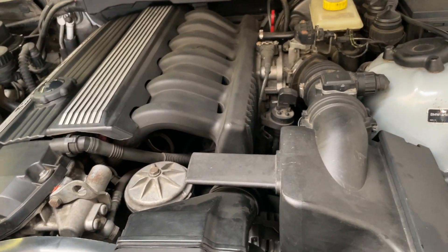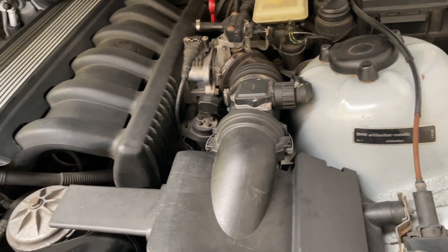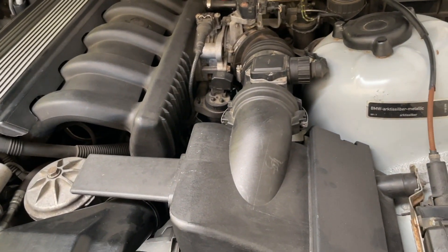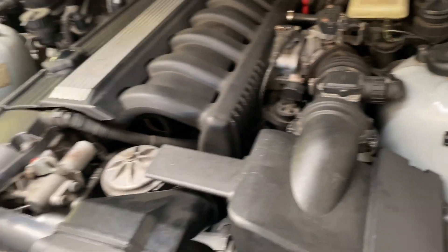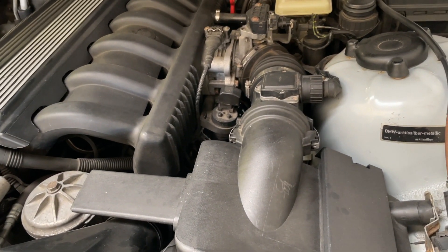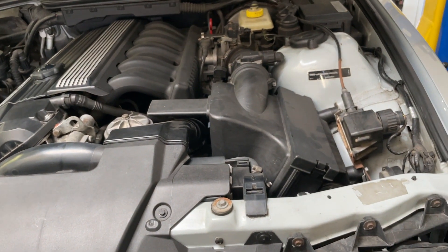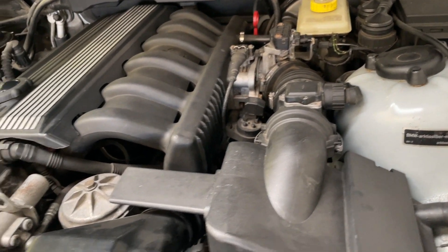But there's been a bigger problem. We got under the car today — my dad drove it to get it warm, put it in the air — and it turns out the hose that goes into a pipe disappearing into the engine was not pressed on all the way and not tightened all the way. That is my fault. Mistakes happen, so we fixed that, topped up the coolant with another cup or so. We'll pressure test it, get it warm again, and it's nice and tight against the pipe and flange now, so that should be taken care of.